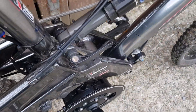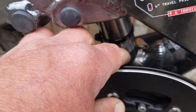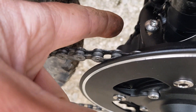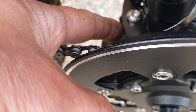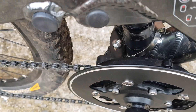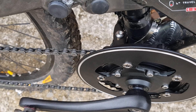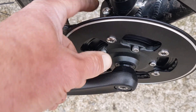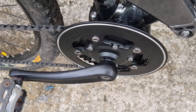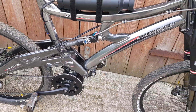One thing I did have to do in order to secure the motor — and it's not the best solution in the world — is basically fit a steel jubilee clip around this piece here. On a normal bike like a hybrid or a hardtail mountain bike, that plate would straddle where the chain stay meets the bottom bracket and secure the motor in place. Without that, the motor has a tendency to pivot forward and move around. But so far so good, it seems to have done the job.